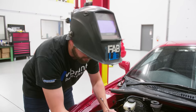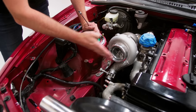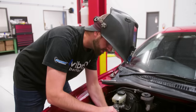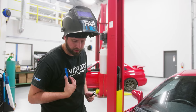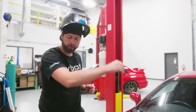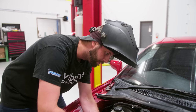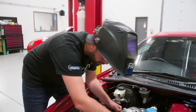All I'm trying to do here is align this HD so that it's parallel with the front of the car but on an angle so that we have a good flow path while still considering where it needs to go. I've clocked the turbo towards myself and then used the elbow to send it back straight. I really just want a straight shot down to the gap that I'm aiming for. A little bit of effort now will pay dividends later.